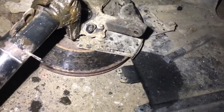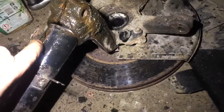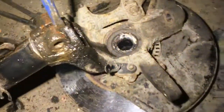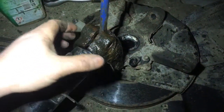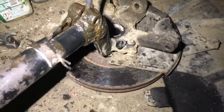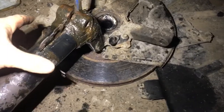I reposition the chisel again. Of course this is the one we're replacing so even if we damage it it's not the end of the world. Now we're going to clean this really well — cover it in WD-40 or copper grease so when we tap it back in it'll go in nice and easy. I've loads of WD-40 on it, copper grease and WD-40 in there as well, and we're going to reassemble now with the new strut. This bit here has to be lined up with that hole, there's a lip just in here, and that's how far it has to go down until this circle here lines up with this circle here. I have the chisel in to open the jaw ever so slightly and then you can manoeuvre it in — keep it fairly square going in and it nearly pushes in. Just give it a little tap with the hammer and it'll actually just suck all the way in.